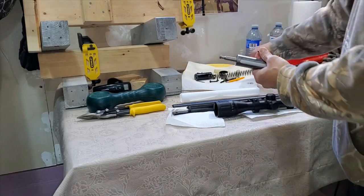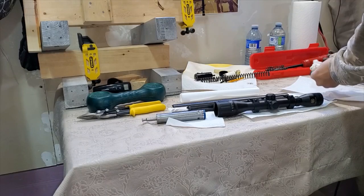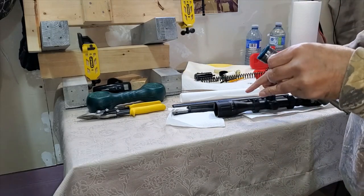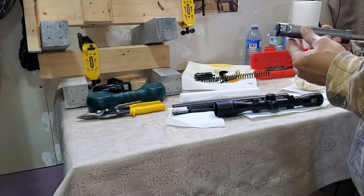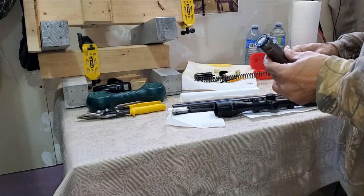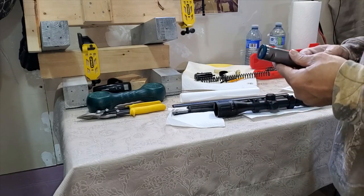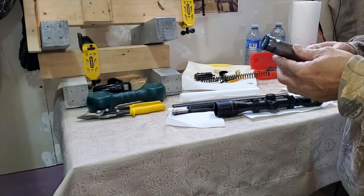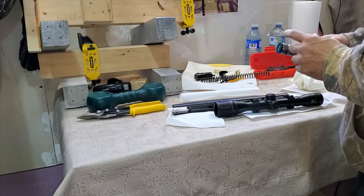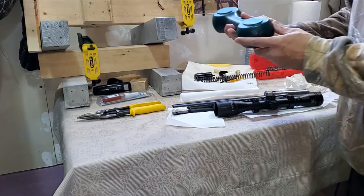Before we go there, I want to demonstrate how this seal fits inside the cylinder. This is extreme tuning — if you are not comfortable with it, be careful, because if you over-cut the seal you can be in trouble and have to buy another one. You have to be very meticulous and slow with the process. If the seal is too tight, you're not getting full power; if it's too loose, you're done. For this I have a 3-pound weight.